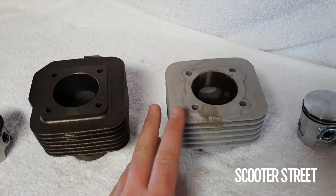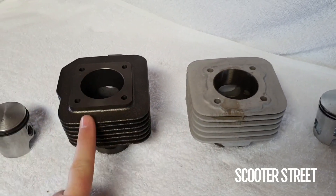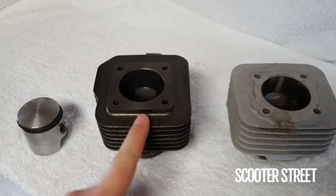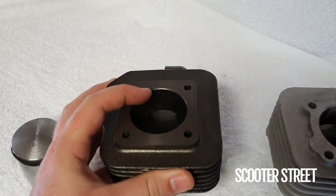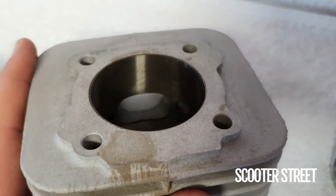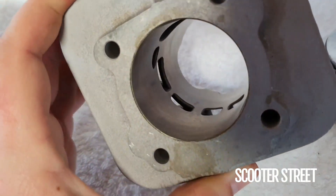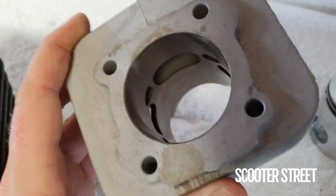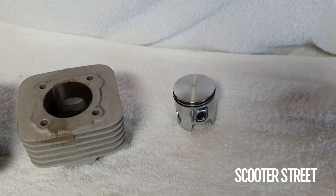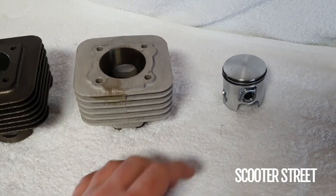A couple of the big differences you'll see: the MHR rep cylinder is alloy as opposed to the cast iron of the sport kit. The other big difference is the sport kit bore itself is also cast iron, you can see in there, whereas the MHR rep has a super tough Nicosil bore. You see that slightly goldish looking plating in there. To suit the Nicosil bore, the MHR rep piston is slightly different and has slightly different rings as well.